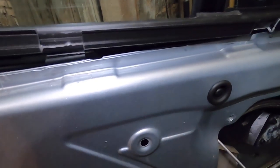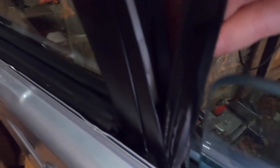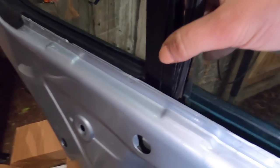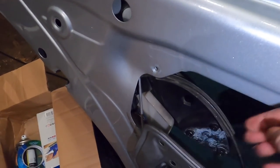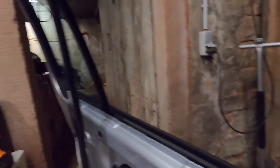This is the bracket that holds the door lock assembly. You just have to push those three plastic bolts through, and then you can actually pull the window bracket off. Once the window frame's out — part of the never-ending process — you have to pull this seal back, and then lift the tab on this white piece, and it'll pull this whole metal frame piece out. And then we can actually get to the door lock. It slides up and out like this. Bolt is out, the door handle is loose — now it should just come out.